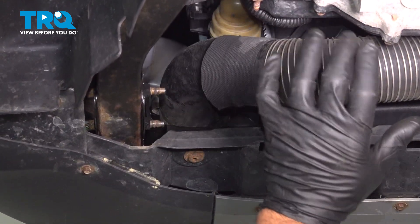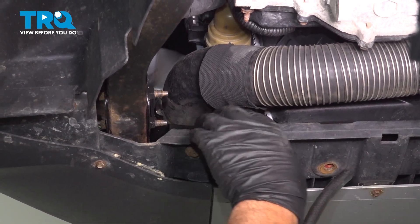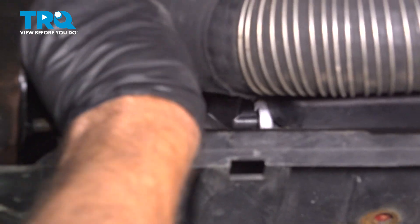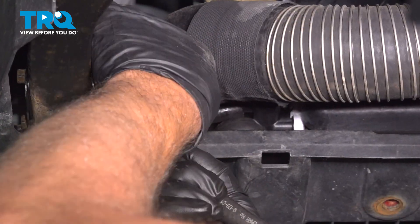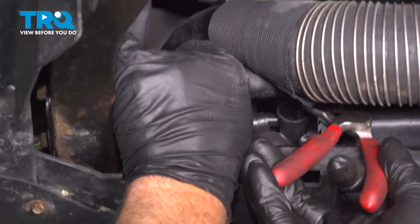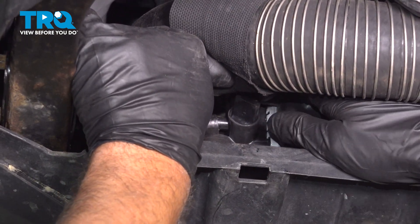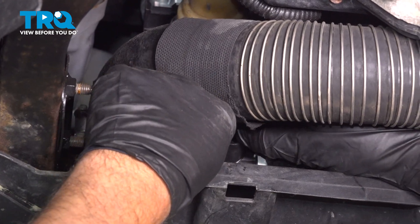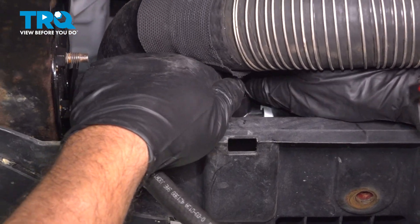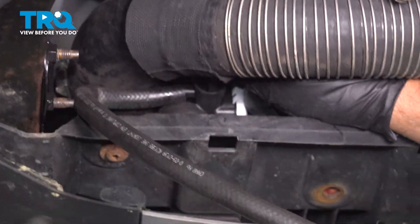Underneath the vehicle, you may have a panel that you need to remove — this vehicle does not. On the driver's side near the radiator, you can see where there's a drain. You can use a hose over the side where the drain is. Have a drain bucket underneath. You can see where there's a wing nut right here. Use some pliers just to get it to crack free, then grab it with your hand and loosen it up. As you twist that, coolant's going to come out the hose — drain it into the bucket. If you want it to go a little faster, you can take the radiator cap off up top.